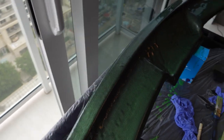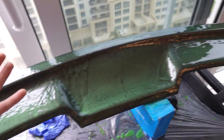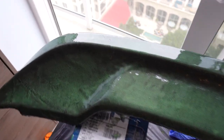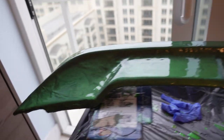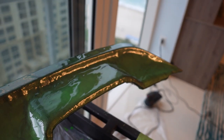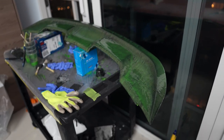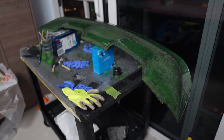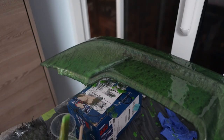That green is really starting to look crazy in the epoxy resin by this stage. Now I have to wait about two hours for the resin to get tacky just like when I did the base coat, and then from there we can add another coat of green epoxy resin. When you do your second coat, you want to put your finger in the resin - if you're leaving fingerprints, that means it's tacky; you don't want it to be soaking wet. I've added yet another coat of resin right there, so we're going to wait two more hours and then finish off with the third coat. Just finished up my third and final coat - now it's time to let this dry for eight hours for full cure.